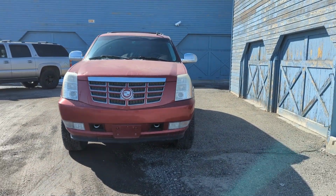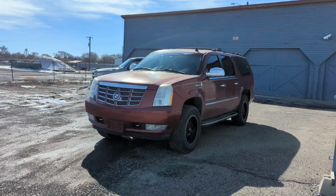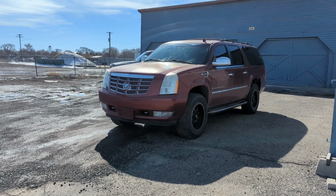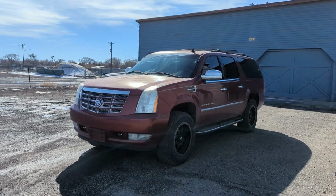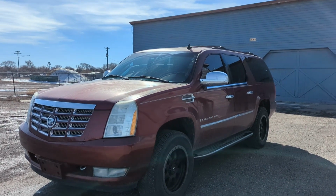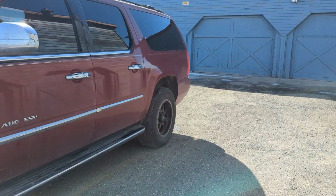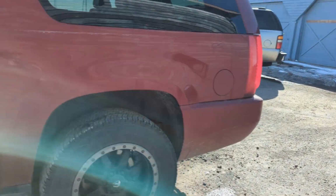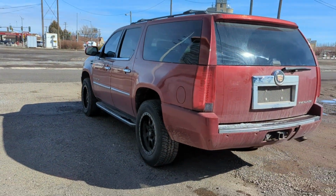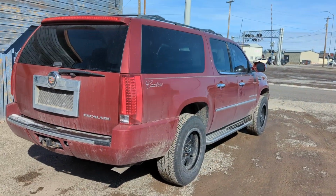So over the years, we've got it down, and made some mistakes of doing it too high or too low or whatever. And sometimes, depending on the vehicle, it really just depends. You can have the same perch setting, and it's a little bit higher. So that's the front. Bilstein 5100 shocks, adjusted correctly. And then the rear suspension is the Moog HD coil that's found on the Z71 models. So it's not like a huge lift or anything. And Bilstein 5100 shocks. But that is the before and after of the Escalade.